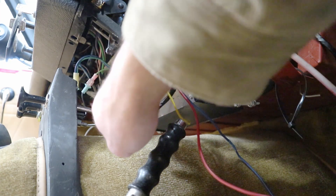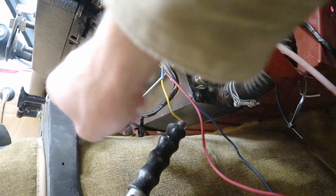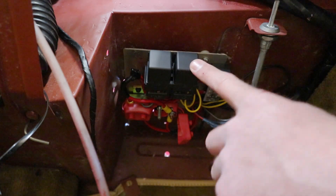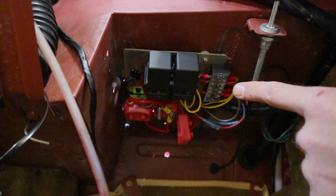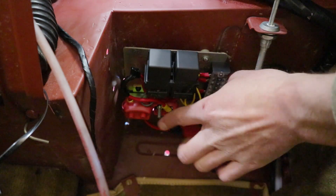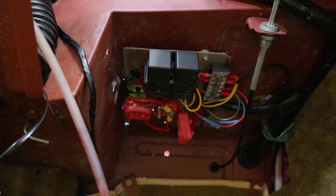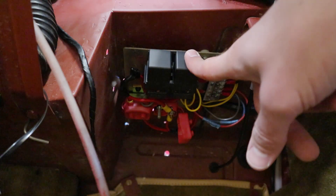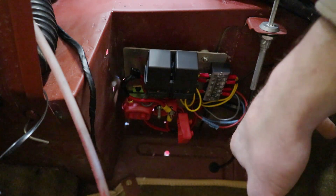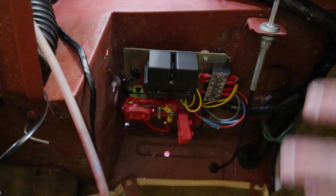I'm aware that the wire harness is supposed to be blue on these cars, but we didn't get the right color tape — mainly I just want the tape there because it helps protect the wiring and keeps everything nice and neat. This is the little panel with relays for the overdrive and the cooling fan that I built, and we stuck it up here in the passenger footwell where it's kind of out of the way. There are two circuit breakers here — again, the circuit breaker did not work with our overdrive, so I'll be putting a fuse somewhere else for that. But you've got two cube relays here for the overdrive and for the fan, and all the wires kind of come in and out of here. I did all the wiring for this in the harness before we put the harness in, so everything's nice and neat in a central location.